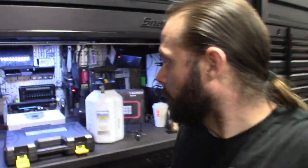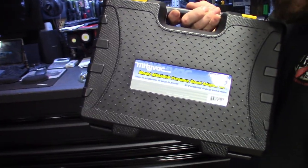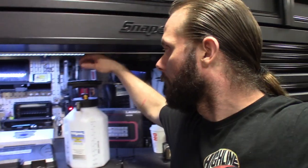That's a wrap-up, guys — quick tools in action on the MightyVac, the MVA 6850. Seems like a legit tool, definitely made quick work of it. I learned it as my first time using it, just kind of flushing brake fluid out as opposed to a full-blown brake job with air in the system. At least now I got the feel for the tank — how much pressure to put in it, how it works. Definitely make sure the bottle is super tight, always check for leaks, and after you set up on the master cylinder, recheck your leaks. When doing a brake flush, take all the old contaminated fluid out of the master cylinder first — start off with the cleanest fluid possible. Can't wait to use it for trans fills, trans flushes, power steering flushes — anything with a drain. As always guys, like, comment, subscribe. Catch you in the next one.